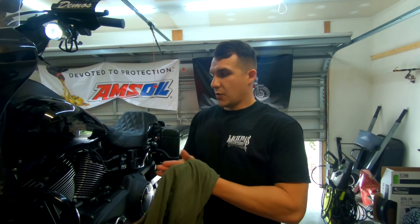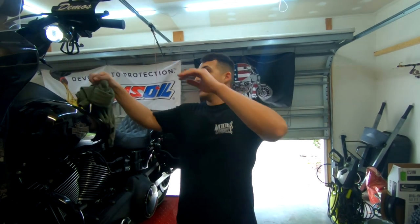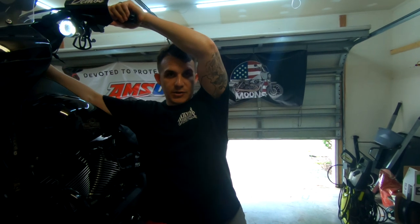All right guys, so we got it all hooked up last night, but it was late, so we didn't want to start the bike and let it idle at like 11 o'clock at night. So I'm going to start it right now. We're going to let it run for like a minute, and then we're going to check the hoses, check the filter adapter, and just make sure nothing's leaking. And then check the oil level.